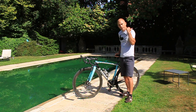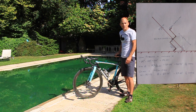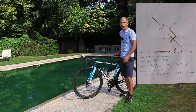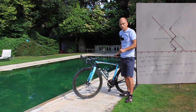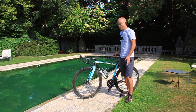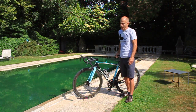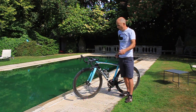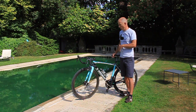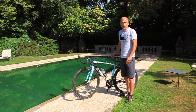If you look at the figures here, for this particular bike we get about 30 degrees of lean before you strike the pedal. And if you lengthen your cranks by five millimeters, then you get one and a half degrees less lean before you strike the pedal, which may not sound like a great deal. But one and a half degrees could potentially be the difference between making it round the bend in one piece and not. So if you want to work it out for your bike, all you have to do is use these calculations — put the four figures in from your bike, and they'll pop out at what degree you can lean it over.